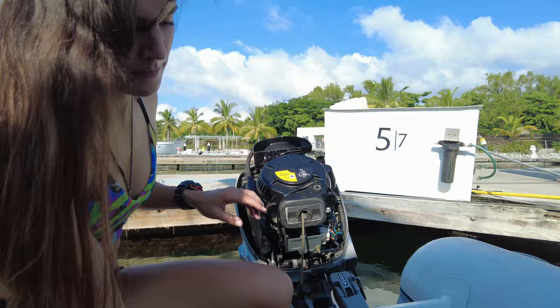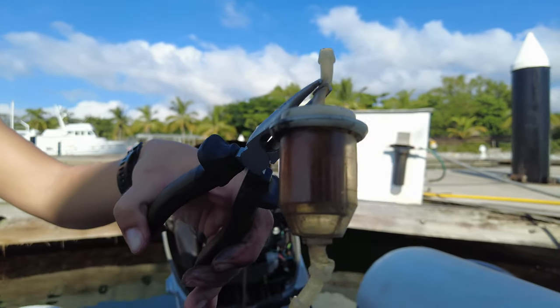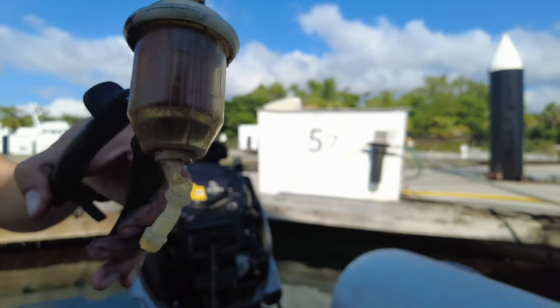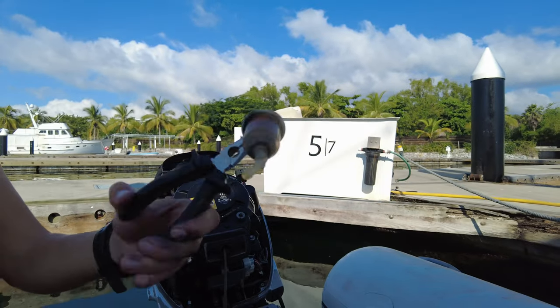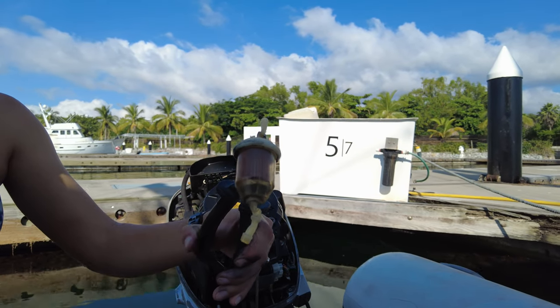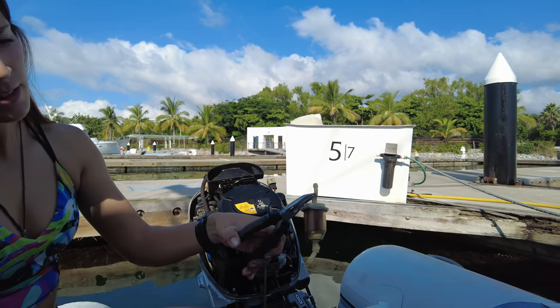So let's see the filter. You can see there are lots of deposits and stuff in the filter. It's sand and grit — that's exactly what it's there for. Unbelievably, it's managed to pass through from the water fuel separator. And there's lots of rust basically.